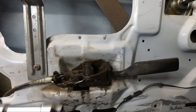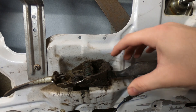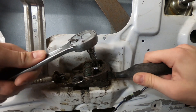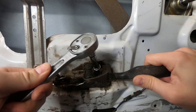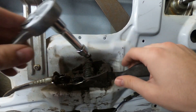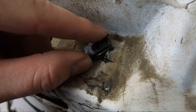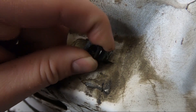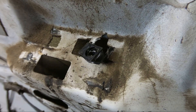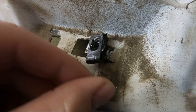While I'm in here there's also a tiny little door ding I might as well fix. I've got a 5/16 socket here — usually people would take off the handle first for access to that bolt, but I'll try to get around it. And that's it — just one bolt holding it in place. As you can see, the metal is just gone, it's ripped, it's completely busted — no wonder it was giving me problems.